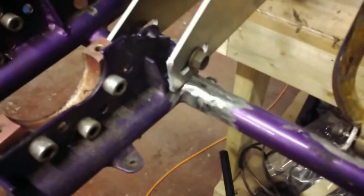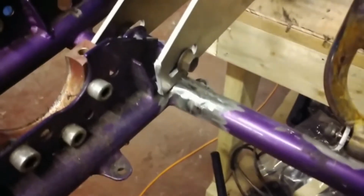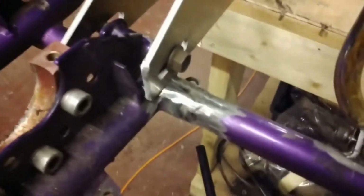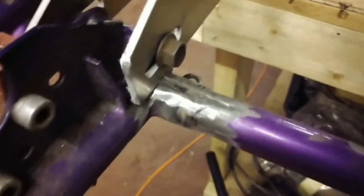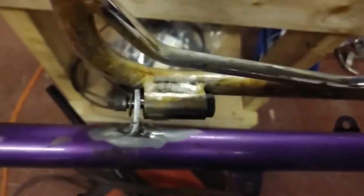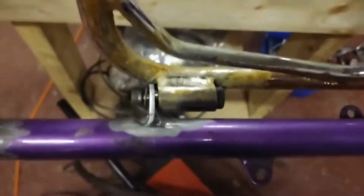hopefully it's in focus. Speaking of which, I'm back on the phone because the wife has taken the cameras to do some work. Who'd have thought it? Yeah, so all that was cut away and re-welded, all done, sorted, adjusted the engine mounts and the engine cradle to fit as well, and we've added the seat mounts, if we can put that in focus there. They've been added and completely custom fabricated out of just 3mm thick sheet metal. So absolutely all sorted on that.